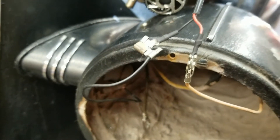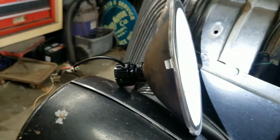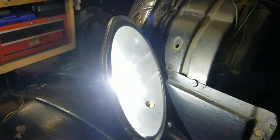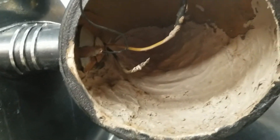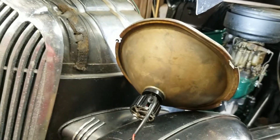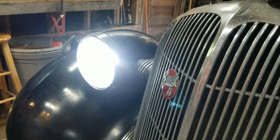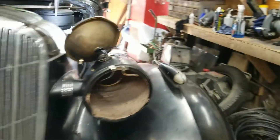I've got it wired up temporarily just to see if it's going to light up — low beam and ground. It is working — it's brighter than the sun. These do have little fans with a heat sink to cool the bulb, and I'm not sure how that's going to react in this enclosed environment. On a hot summer evening, I don't know if they're going to overheat or not — I guess the only way to find out is to drive it. I'm still running on two transformers. There's no heat buildup, which I'd expect; if there were, I'd be worried.